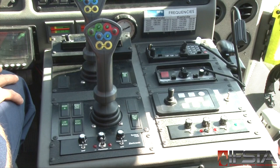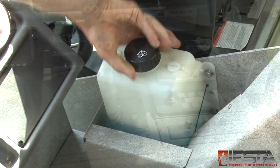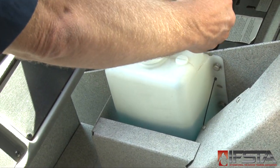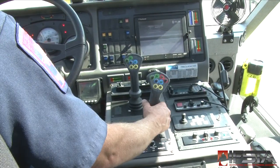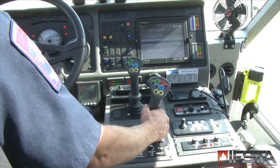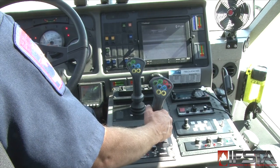Also check the controls for any computer equipment in the cab — mobile data terminal, mobile computer terminal, etc. Check windshield wiper controls and the fluid reservoir in the cab, window defroster controls, load management system, pump, turret controls, turret valves, and the drive system interlock control.